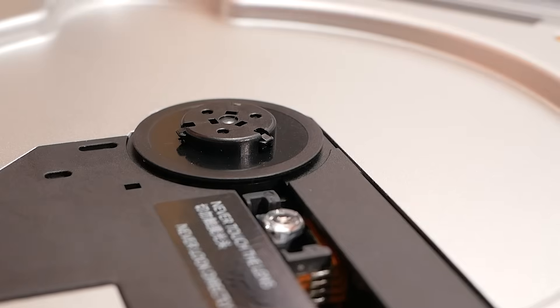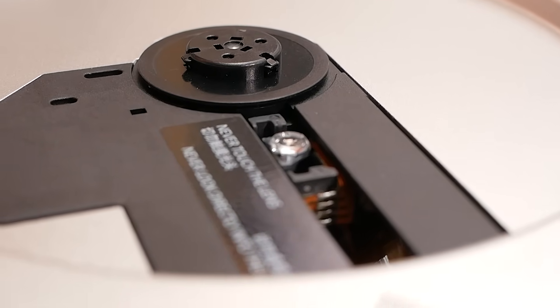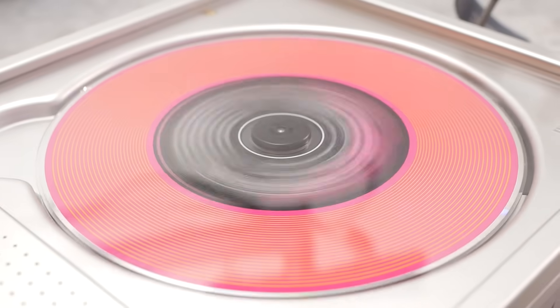Let's start with a really basic explanation of how CD players work. You've got a compact disc that stores digital music, and a CD player uses an optical laser to read the music off of the disc as you listen to it. There's actually a little lens and a laser light that the player uses to read the surface of the CD as it spins in physical space. But if the CD player gets physically bumped, it can — and often did — disrupt the laser momentarily, causing the music to skip or stop playing for a second or two while the laser realigned itself.